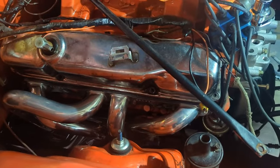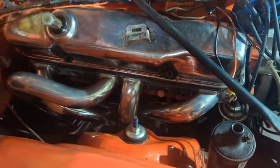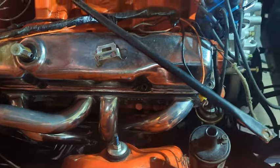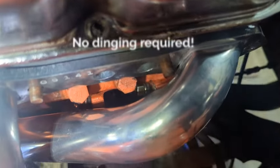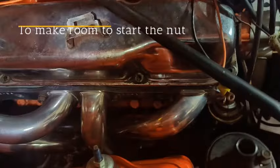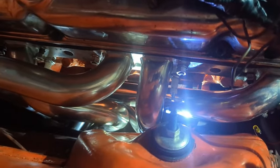Once it hit the perfect spot to get lined up, we were good to go. Clearance is good — it does not touch the torsion bar. Of course I've still got to put the drag link, tie rods and stuff back on. The only thing I noticed is right here on the front — there's actually a factory dent there which isn't quite big enough, so we'll need to dent that a little more to get the nut on that stud. Off to the driver's side.